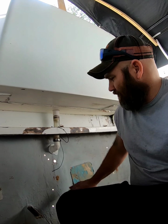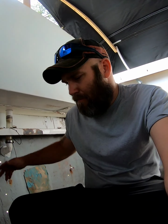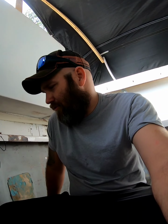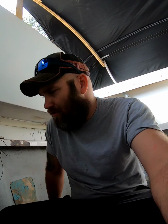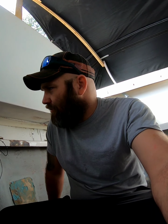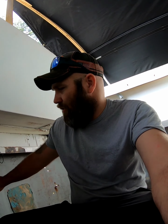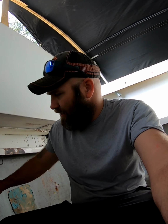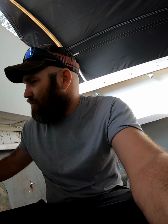So what I'm going to do is fill with a polyester structural repair putty. I'll either mix up my own or they sell it as well. Actually, I'll probably just buy it for ease of use, or get the stuff they sell. I'll fill the holes, then put up a 1708 patch on the inside. And I may even do chop strand on the inside as well.